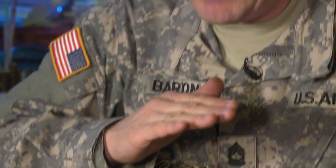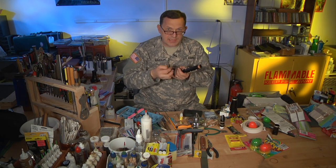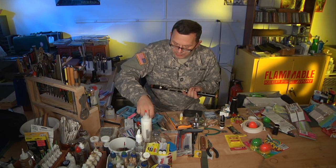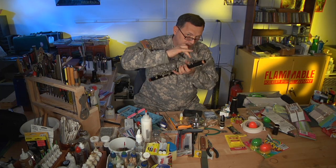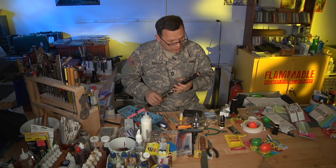Typically, when you put that pad back on, it's going to seal just a little bit weird because of the thickness of the super glue. So that is a prime time. Take just one layer of the Teflon tape, cover the pad before you put the key back on, put it on, press down just lightly. It should be nice and sealed. Should really hold you until you can get it fixed.